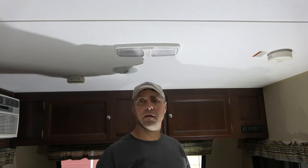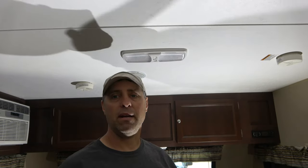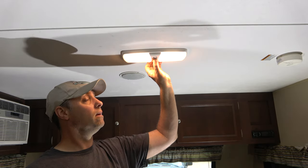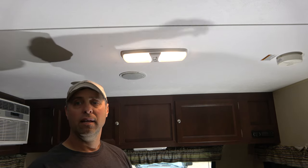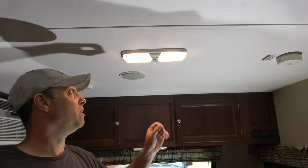I'm going to hook up the battery and test it to make sure it works. Battery's hooked up — let's turn it on. One way turns on one light, the other way turns on both lights — it works perfectly. Now I'll hook up all the rest, but before we do that let's head to the shop and do a little bench test to see how much power they draw.